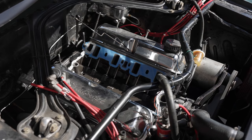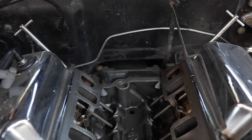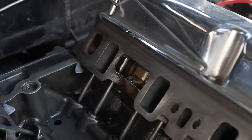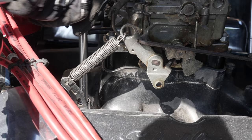I've also seen on some forums that some people machine their intakes to match their heads, and of course my engine has been modified — it's not stock at all, the previous owner did a bunch of stuff to it — so that's also a mystery. I was like, well, the old intake didn't leak, so let's just put it on and if it's still leaking then we know it's another issue.